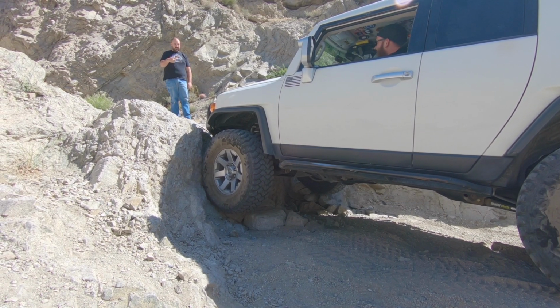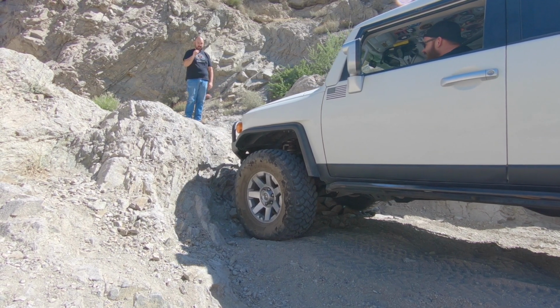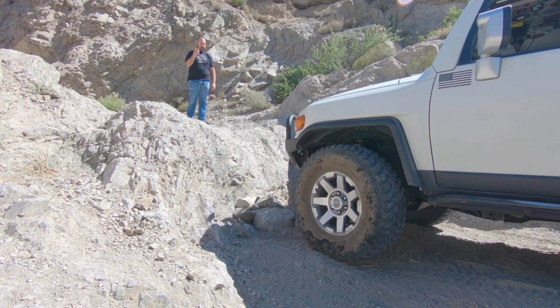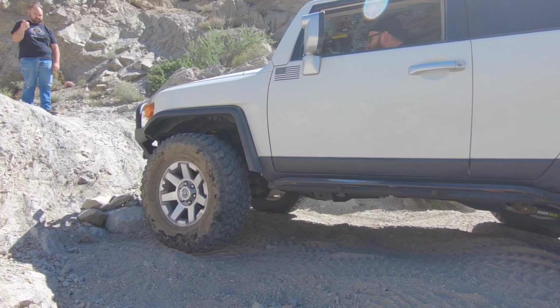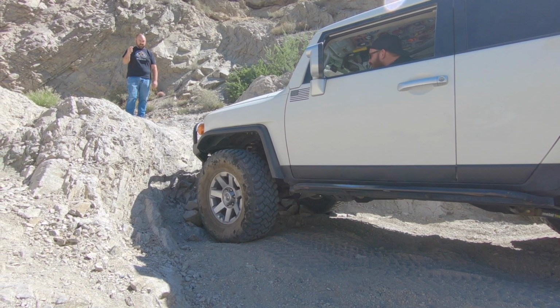I'm glad I have a little bit extra paint on the shelf. Those are steel, right? 1/4 inch steel. Definitely wanted to go. I would bite the weight there, keeping the CG low. So there's the front motor skid plate, which goes from the cross member all the way back to the start of the transmission. Okay. And then from the transmission, there's an intermediate skid that goes from there to the first cross member.